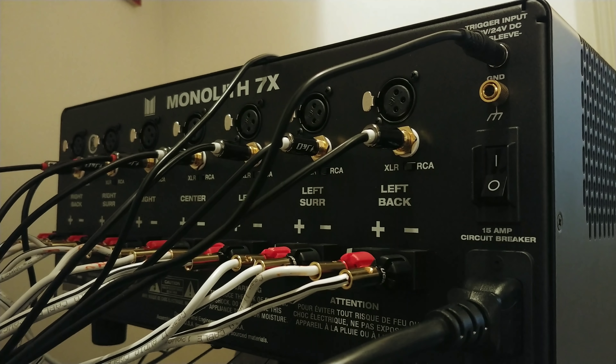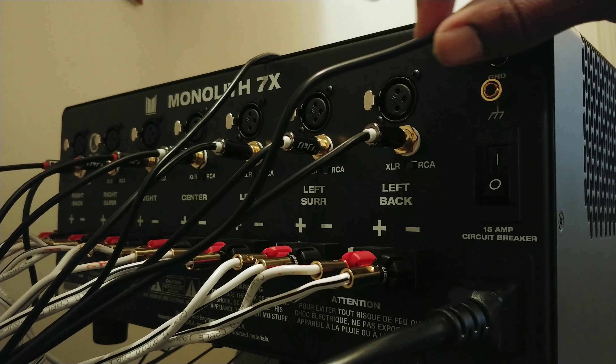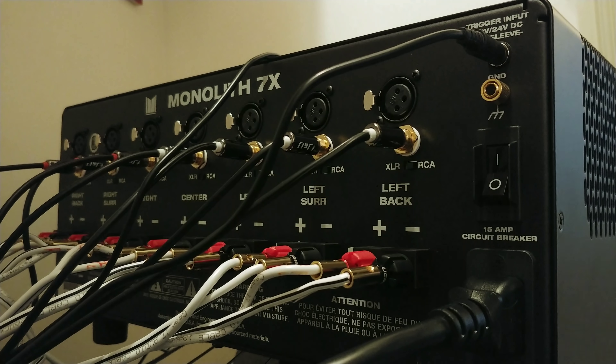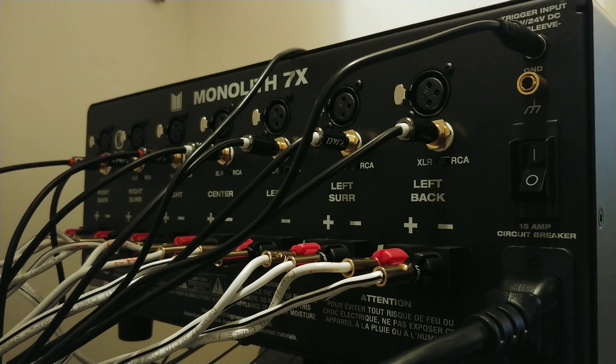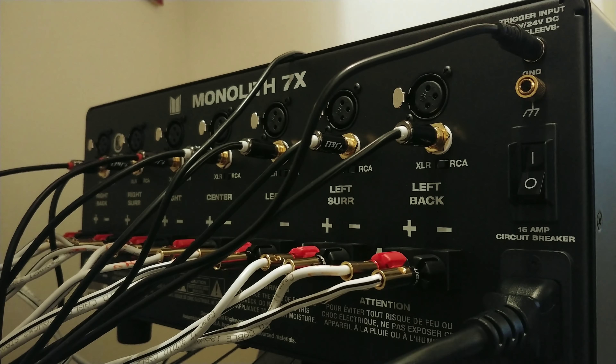Now let's talk about how to power your power amplifier. Of course it comes with a power cord, but turning it on is a bit different. Most if not all amplifiers come with a 12-volt trigger, which is just a 3.5mm to 3.5mm jack — kind of like a headphone jack. You plug one end into the trigger output of your receiver and the other end into the trigger input on your amplifier. I'll show you quickly — this is the input on my amplifier, and that cord plugs into the trigger output on the receiver. You can see 'trigger output' right there. Once plugged in, when your receiver turns on, the amplifier automatically powers on as well.